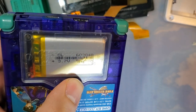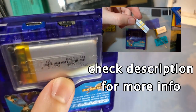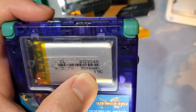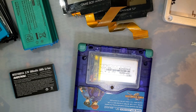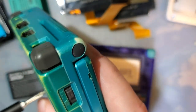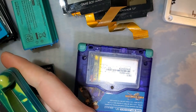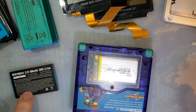I did the exact same thing with one of these batteries — this is the mod battery I did a little while back with the custom PCB, just solder it to the PCB and drop it in. I actually ran this battery through my tester as well. This one is 900 milliamp hours — 20 milliamp hours more — but it tested at 837 milliamp hours. Not quite as high but still pretty decent. Keep in mind I just tested the one.